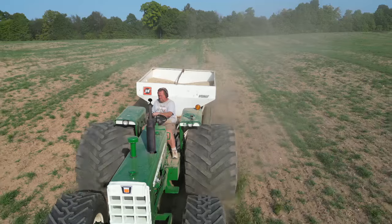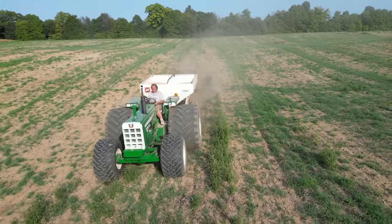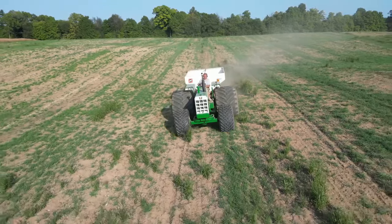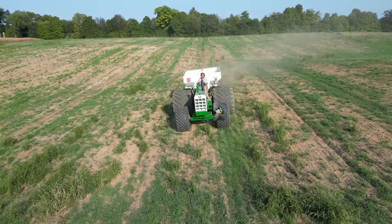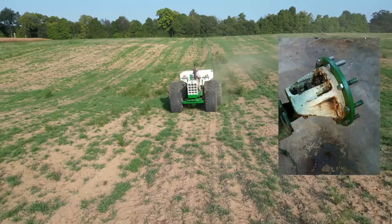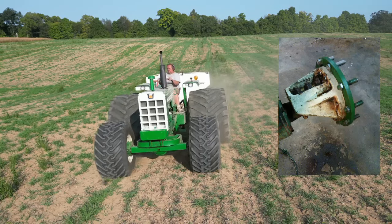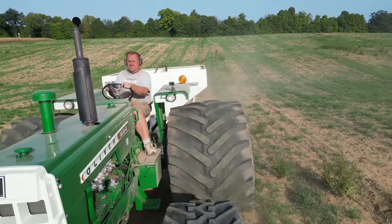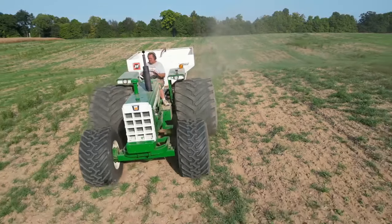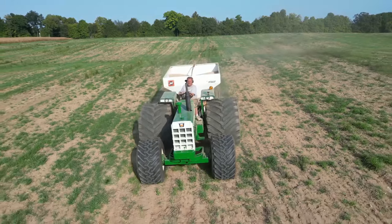And one other thing I found, and it must have been an update, because some of them didn't have them. I don't think Herman did when I first got them. But one of the later books showed a jam nut on the backside of the studs for the adapter plate. And that made sense to me, because the studs just threaded into the adapter plate, and so the lug nut could come loose. By having that jam nut on the backside, you pulled the threads tight inside the adapter plate, and also gave it more surface area on the backside to keep it from pulling through or coming loose.